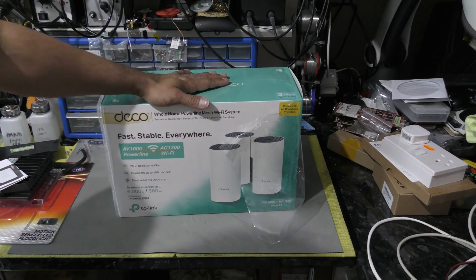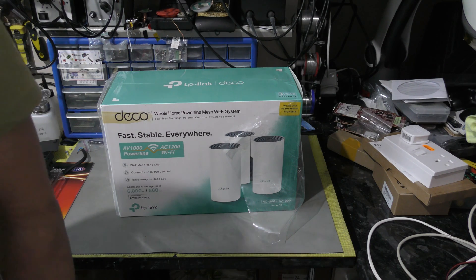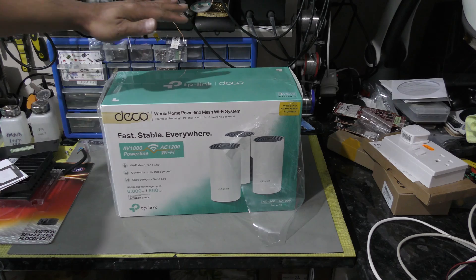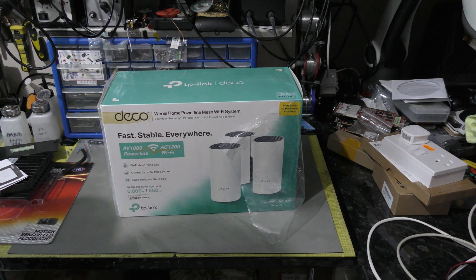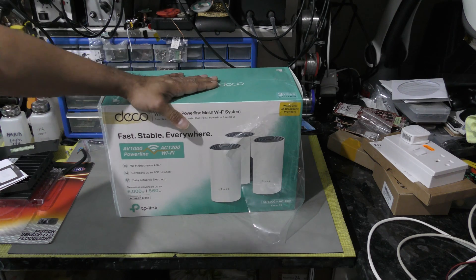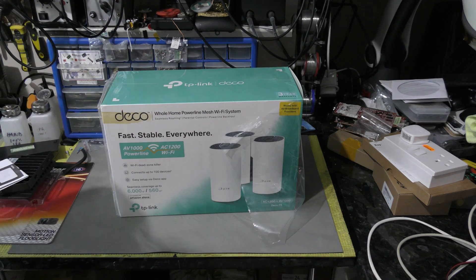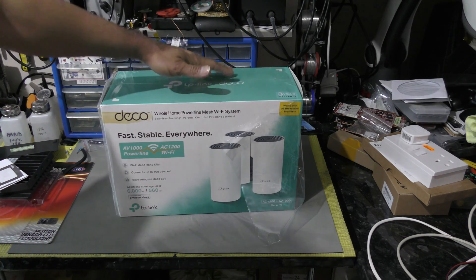So this is where the mesh system comes in. The other issue with the powerline kit is that it only broadcasts on 2.4 GHz — it's not on 5 GHz — whereas this Deco P9 should broadcast both frequencies, 2.4 GHz and 5 GHz. And that's where I went wrong. Some of my appliances only support 2.4 GHz. With mesh systems — whether Netgear, TP-Link, or various other brands — you've got to be careful what you're buying. Don't just randomly go and pick something up like I did. This is a decent unit, the P9 series, which has literally just come out.